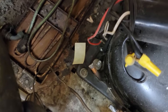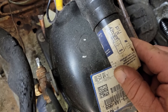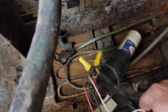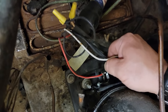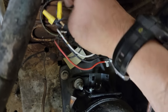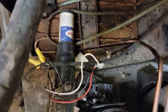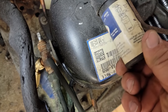This freaking compressor is so freaking hot it's ridiculous. White is start, common is black, and run is red - so just remember run is red, black is common like it usually is. We could have just hooked right onto the end of those. Wow, that is some nice stuff right here. I would suspect this might be broke - it could be just bad. It's half the size of my other one - I wonder if it went bad.